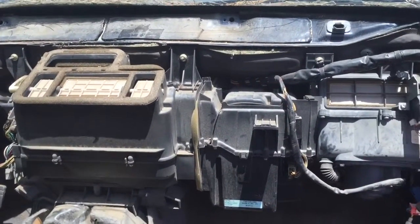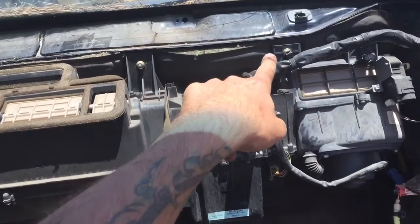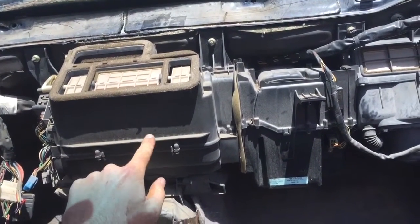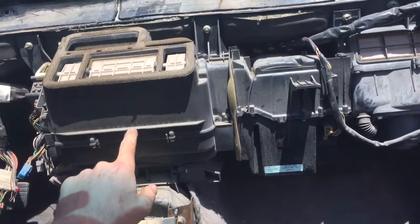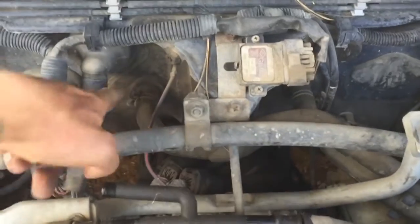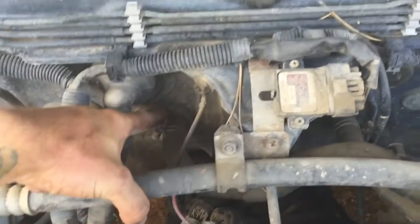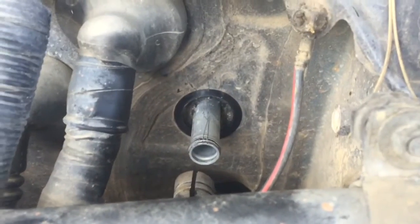Now that the safety bar is out of the way, we're gonna approach getting the heater core box out. There are quite a few fasteners on the bottom as well, but the first thing I'm going to do is go to the engine bay side and remove the intake air ducting so I can reach the back side. Disconnect the heater lines that go into the heater core and take out the little rubber o-rings. Here are the heater inlet and outlet - just 8 millimeter head worm screws, undo those, then cut the line and take those hoses out. Pull those rubber o-rings out with a pair of pliers and you'll have the exposed heater core nipples.